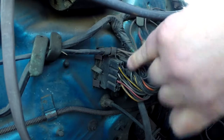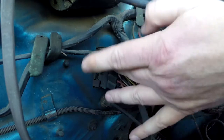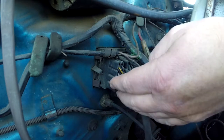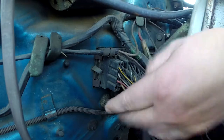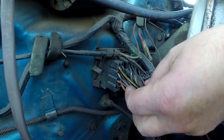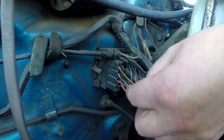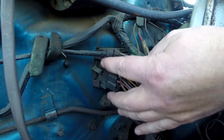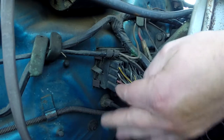There are three large connectors here — I think there's four and eight pins on each one — and that's for going through the firewall. This is a notorious place where stuff gets burned. Sometimes you'll see these plastic pieces all melted. I don't see any right now, but essentially all the electronics go in and out of here. On the 64 Chrysler that I already fixed, I had to find an unused hole, drill through there, and run my own replacement wires through to the car.